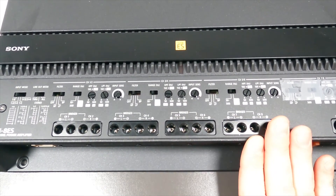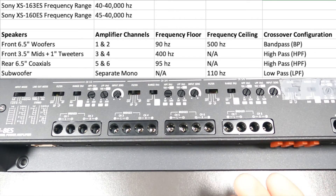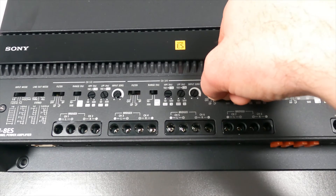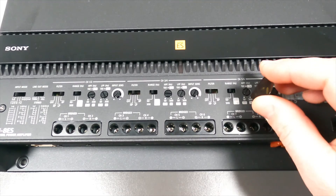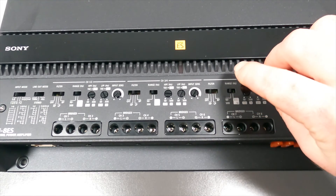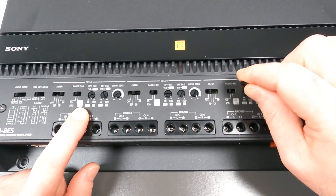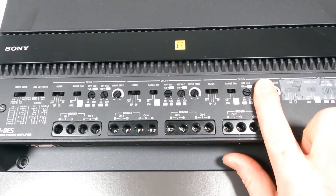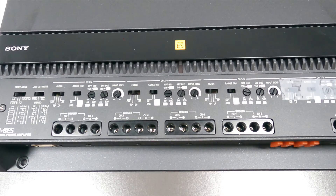Finally, for those rear coaxials, I chose a minimum between 95 and 100 Hz. I'm not looking to limit the upper threshold of those speakers, so I'm going to use high-pass only. I'll set the high-pass a little higher than I did on channels one and two — somewhere between 95 and 100 Hz. Low-pass isn't going to be used for this either. This channel is now set up for the rear coaxials.